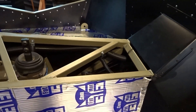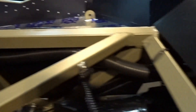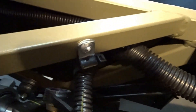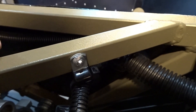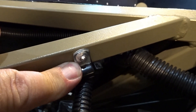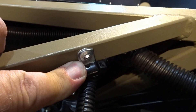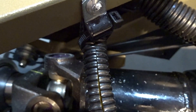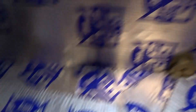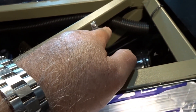I'm not a big fan of using tie wraps everywhere — I prefer to limit their use and use cushion clamps instead. You can see we've got cushion clamps here and there to hold the harness in place. But in a case like this where you're crossing a frame member at near a 90-degree angle, I put on one of the smaller cushion clamps — the quarter-inch ones that come with the kit for your brake lines — and then run a tie wrap through it. Then I use a pair of flush cutters so there's no tail sticking out to cut yourself, because those things can be lethal.